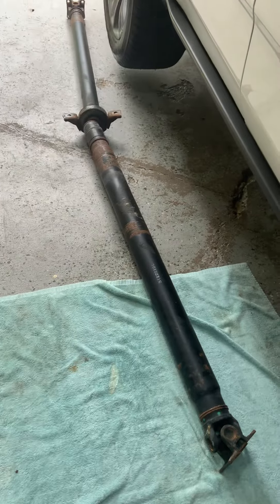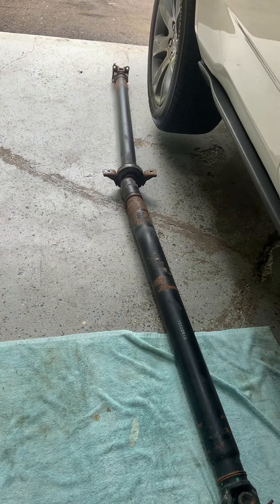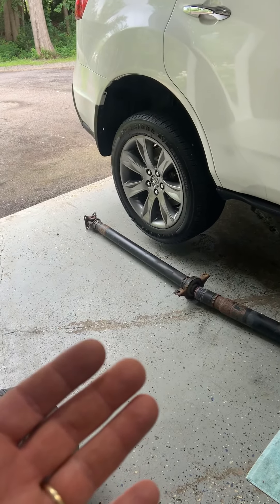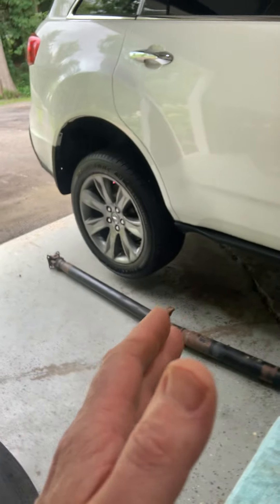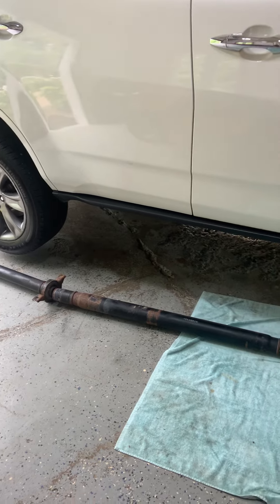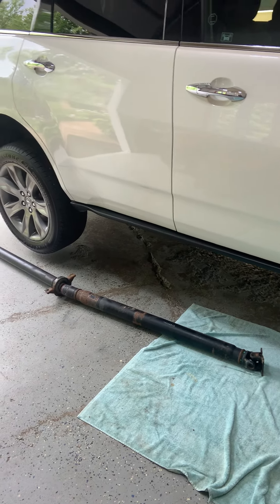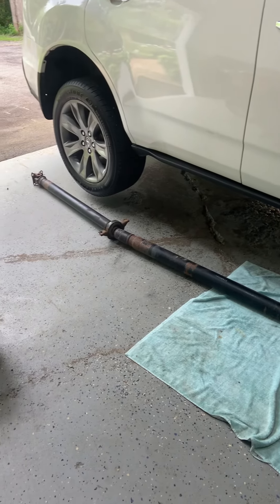We're hoping this is going to solve the issue. I'm pretty sure that's what it is because of the way the vibration went through the whole vehicle. It wasn't like a typical wheel bearing, which will make some noise but you don't really feel it that much. And when you turn the steering wheel left and right, it loads and unloads the bearing and you can hear the noise changing — this wasn't doing that. It was making a vibration that at a certain frequency got quite violent at around 60 to 70 kilometers an hour, so 40 to 50 miles an hour. The faster you went, the frequency picked up, and it didn't matter if you were on the gas or off the gas — it just made this horrible vibration.